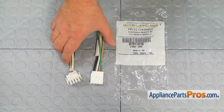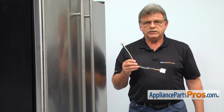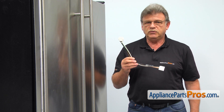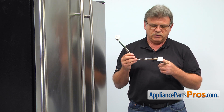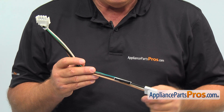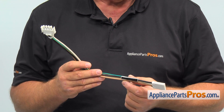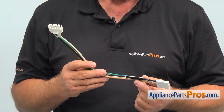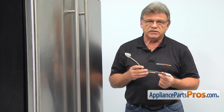When you open up the package you're going to get a new ice maker wire harness. The ice maker wire harness connects the ice maker to the electrical system of the refrigerator. It has two plugs — one connects to the fridge, another one connects to the ice maker. The ice maker wire harness has a built-in thermal fuse. In case the mold heater inside the ice maker gets stuck in heat mode and the temperature rises to unsafe levels, the fuse will burn, cutting power to the ice maker. In that case the wire harness must be replaced.